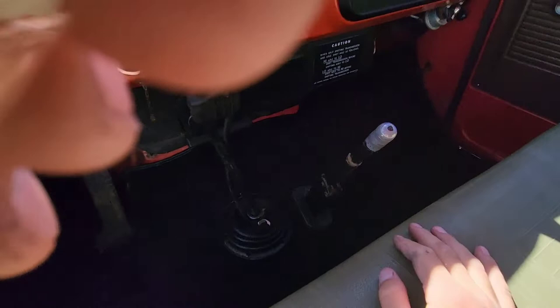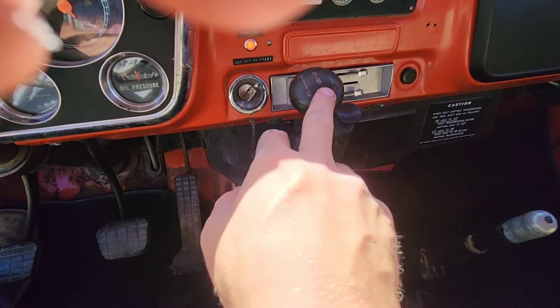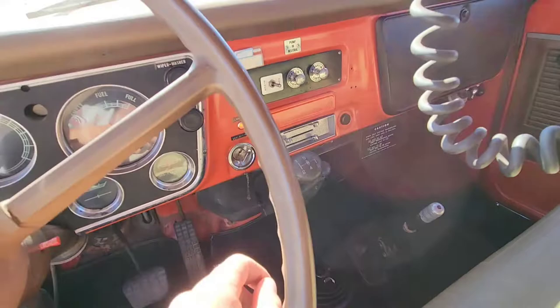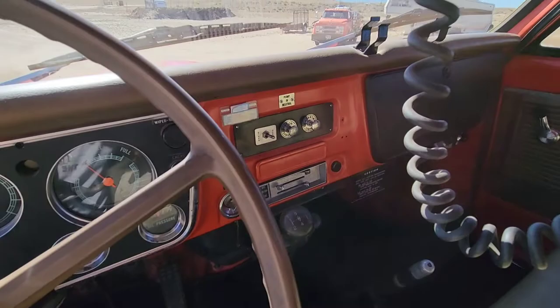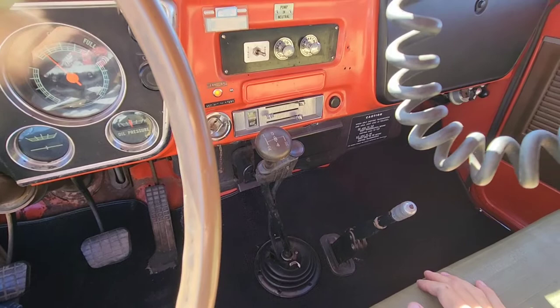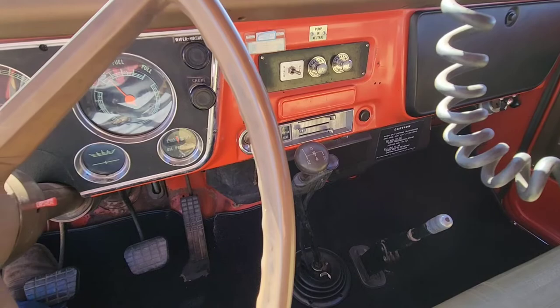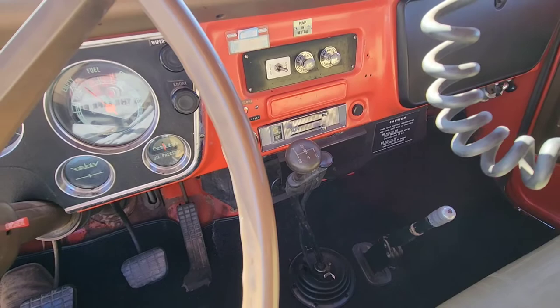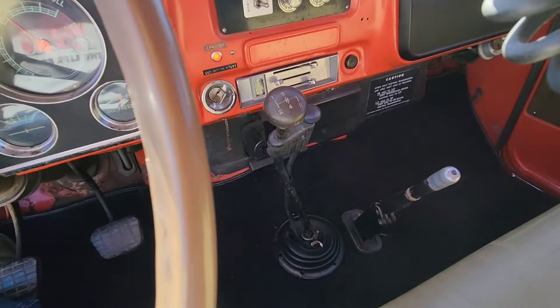And then you got, so this is a 4-speed transmission with a splitter. It's a 2-speed rear end, so if you're not familiar, every gear has a high and low side, which really makes it nice. In fact, I wish my C40 over there had that, but mine's just a basic 4-speed, nothing special. With the 2-speed rear end, it really helps you get that low extra power, especially if you're hauling a big load, with a water tank back there, 700 to 750 gallons worth of water, and this great big truck. It helps you on hills if you can go on the low side of 3 and then slowly work your way up through the gears. So yeah, that makes it really nice, works really well.